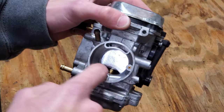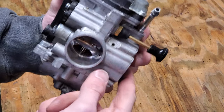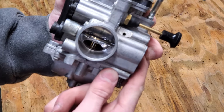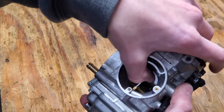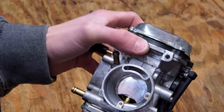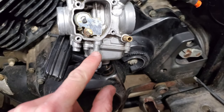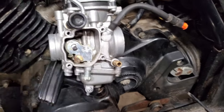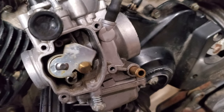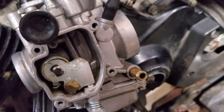Before you do that, make sure the intake and exhaust of the carburetor is clean and free of any dirt or contaminants. Make sure this opens and closes freely and doesn't bind up. We're going to go ahead and reinstall this on the quad. Once you put the throttle cable on, make sure it goes all the way down to idle — this is your idle speed adjustment, make sure it's touching that — and then it goes all the way up to full throttle, which is when that plate touches the body of the carburetor. Do that a couple times, make sure it's working good, and then you can put that cover back on.